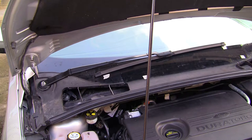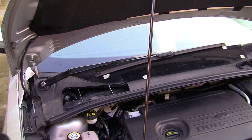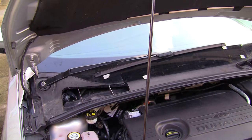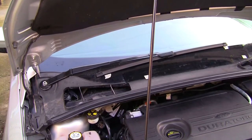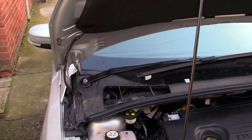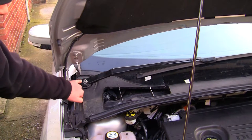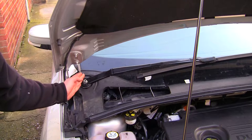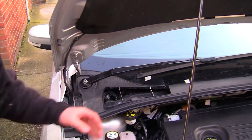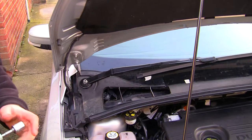This is why, I'm not sure how much you can see on the camera, I marked all this up with tape, so when I drop these on, I've got a good idea of whereabouts to wear them. We'll test this all in a minute and I'll show you it works alright. One thing I was mentioning earlier is when you take these off, if you've got an impact like this that zips it off really fast, then you're not chancing this whole part moving around. It's on little notches, it needs to be back in pretty much the same position. If you're trying to do it manually with a spanner, you're probably not going to do it.